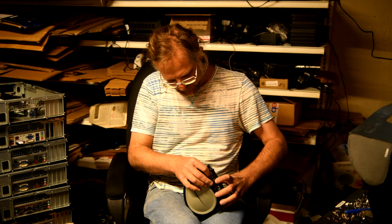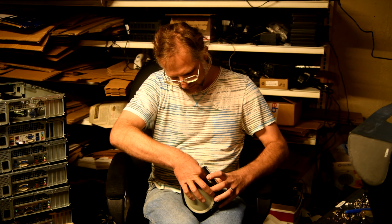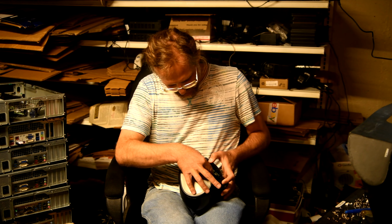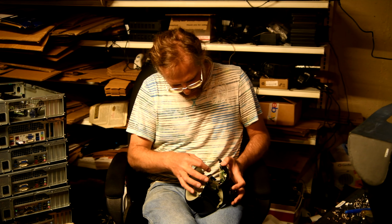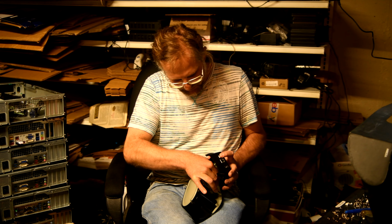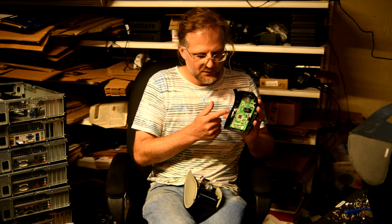And there's 3 ribbons that connect to the print head, 2 smaller ones and a big wide one. There's a cord that connects to, I'm guessing, the DRM module there, and then there's another one that plugs into the motor to move the paper. So this is the board out of a 550.